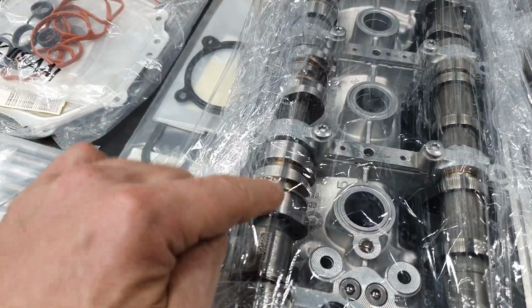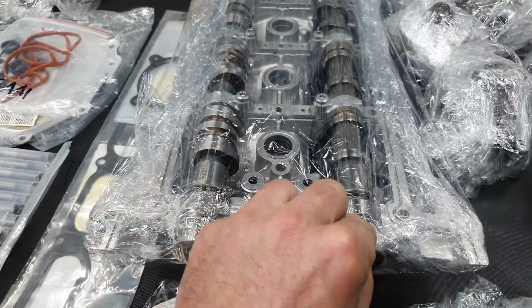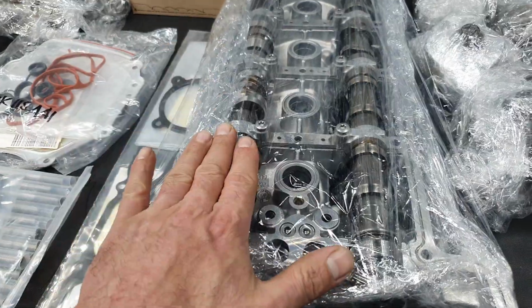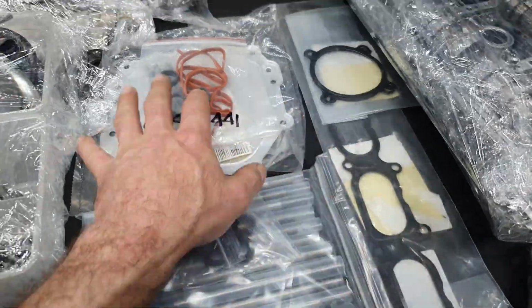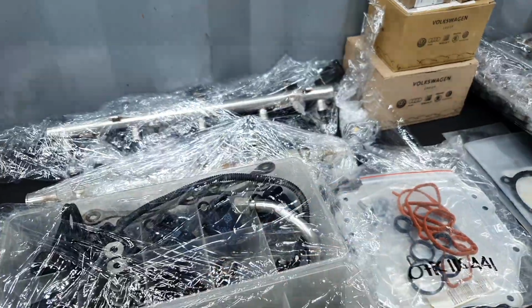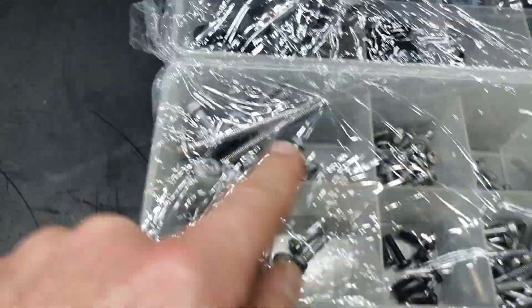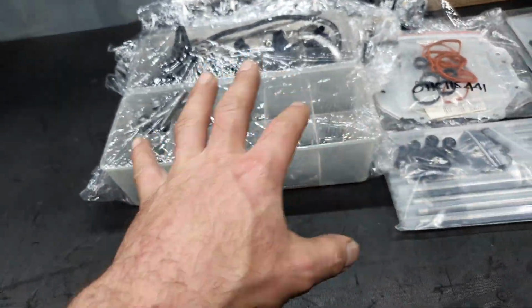I put the new camshaft in place with assembly grease to be ready. Okay. The exhaust camshaft is in place. Intake camshaft is in place, being torqued down. Alright, studs here, gasket seals, front. Okay, the fuel injectors I already replaced. I put the upgraded one, the big one. The high pressure injectors are on the cylinder head with the spark plugs. The new bolts I have here, I have replaced a couple of bolts. These are the new bolts. The solenoids, the actuators, stuff here and there.